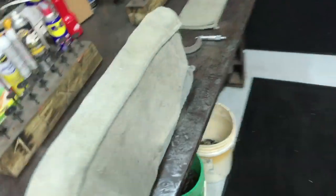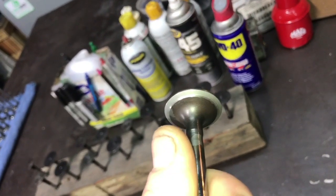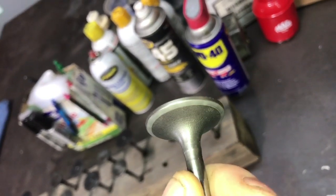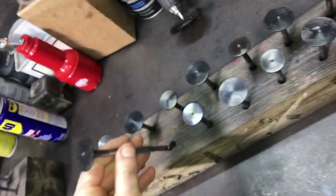Tanner's got the valves out and clean, they're not ground yet — they're just waiting. Those are actually for those heads. This is how I keep track of the valves after they're lapped in. We go ahead and lap them — those are ready for final assembly. See the margin right there? Actually, these are done — he's got all of them done.